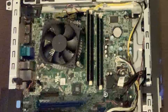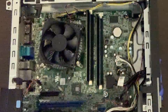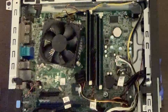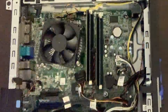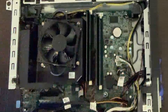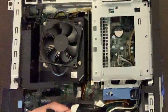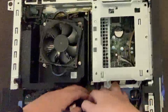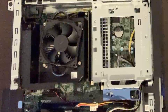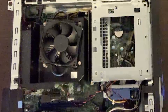That's about all we've got for the main components. The final step is to take any cables you unplugged while doing this — I've got two SATA cables — and just effortlessly cable manage them in. Then you want to take all the accessories you took out at the beginning, like your shroud, and throw them back in. Put your hard drive cage back in too — if you had an old hard drive, you would take a SATA data cable, plug it in, and a SATA power cable as well. I don't have a hard drive at the moment, so I'm not going to bother with it.